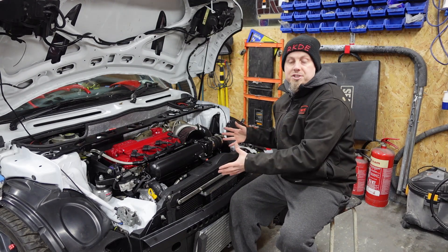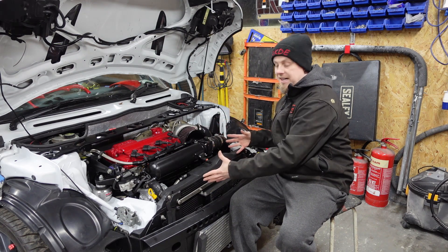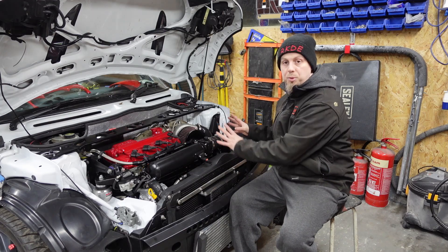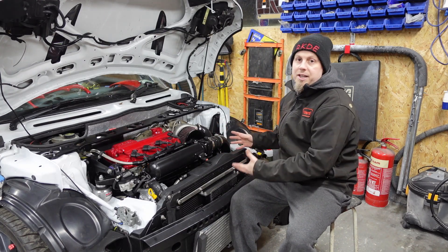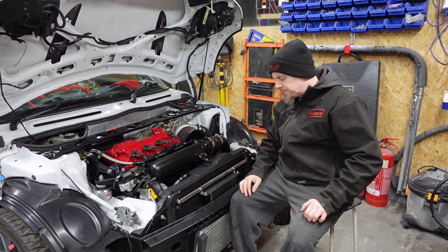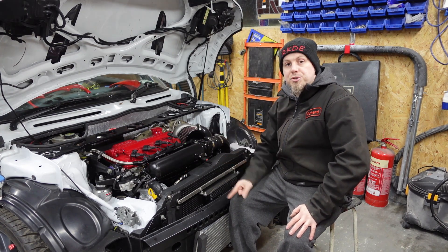Other things you're going to have to consider is all of your coolant routing. We discussed in some of the earlier videos how I've done my turbo feed and return lines back down to the water pump and from the thermostat — you've seen that in the photos. Next, you're going to have to consider how to get coolant to the radiator and what radiator to run.